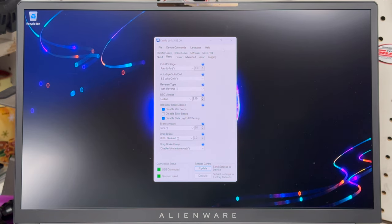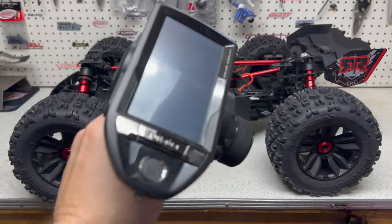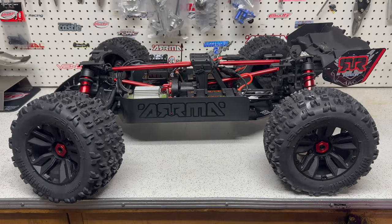So I'm going to drop it down to 7.4 volts. Today when I show you the servo performing, just remember it's running at 7.4 volts, not the 8.4 it should be at. At some point I may change it — it'll depend a lot on how it performs at 7.4. At that voltage it's somewhere around 980 ounces of torque, which is still a ton. I'm going to get all the gear back in the truck, get everything set up, and then we'll go outside and check out the servo. Batteries are fully charged to LiPo voltage — 4.2 volts per cell.